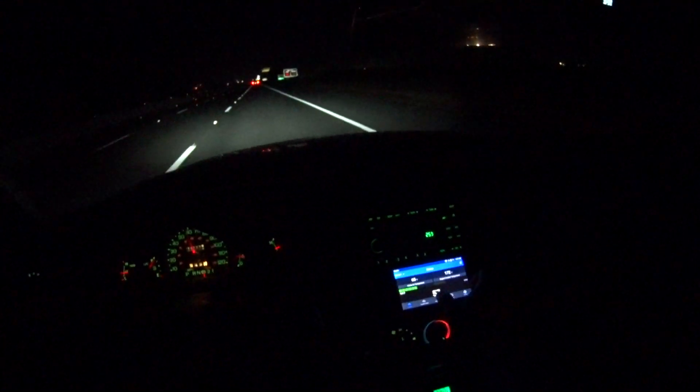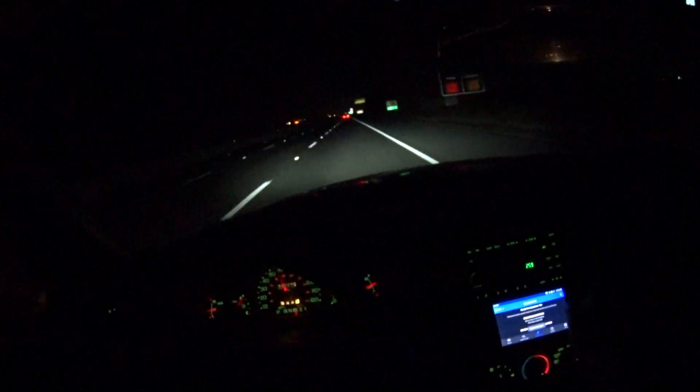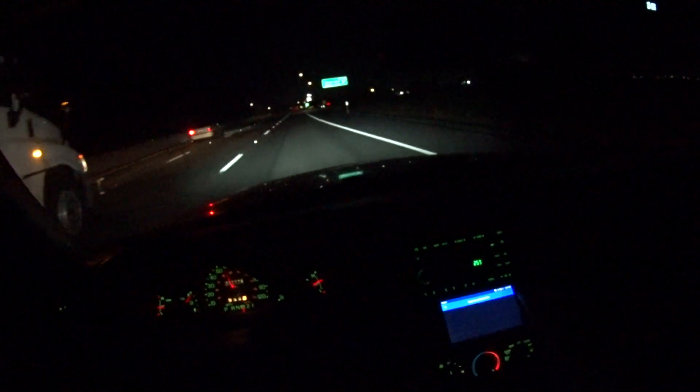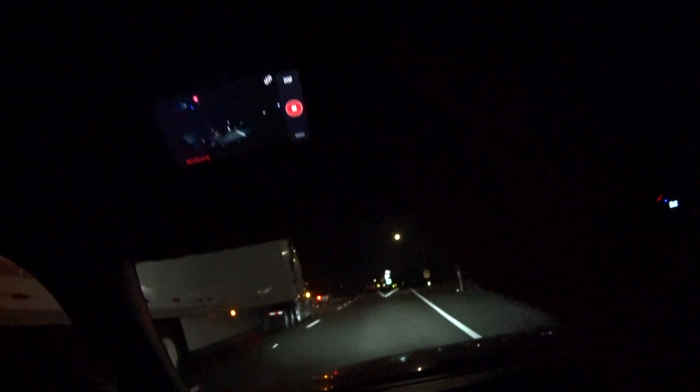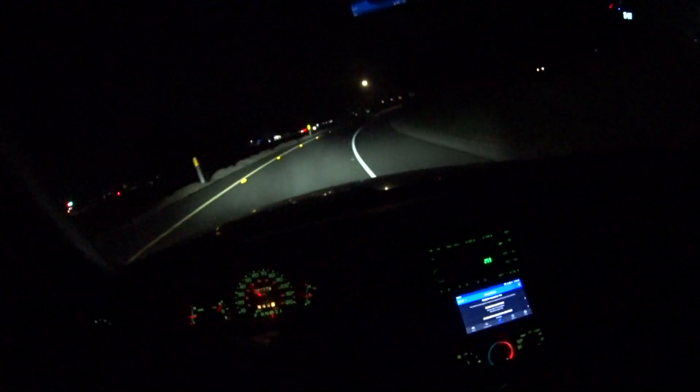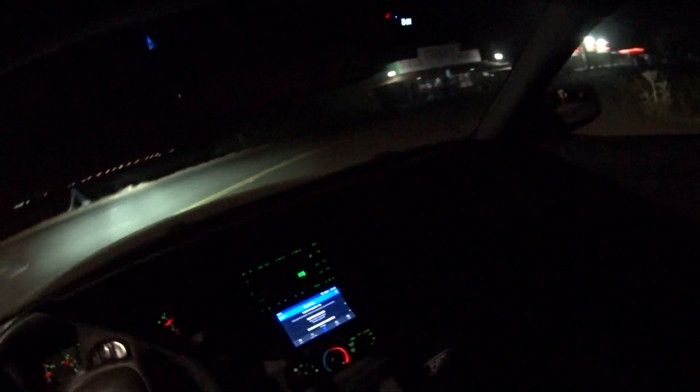All right, I'm coming up on my exit. Let's check these monitors. It looks like we did it — it says zero incomplete. I apologize for that swerve — highway patrol probably thinks I'm drunk. So we're at 14 minutes, and I've been filming for 12 minutes. It looks like I got every single monitor to run within 12 minutes. I'm going to pull over here and show you on the scan tool.